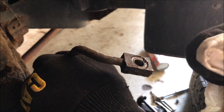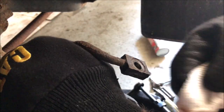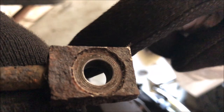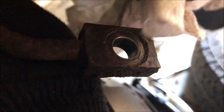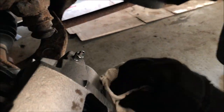Now let's look at the caliper brake line — mine is a little crusty, so I'm going to chip off some rust on the sealing surface. Don't use a flathead to gouge it — there are little rings or grooves going around the fitting, and the copper washers have those too, which helps them interlock and seal. Just wipe it off with a rag to get any loose debris out of the way. If it's too far gone to seal properly, you might want to replace the line.